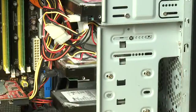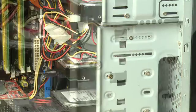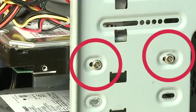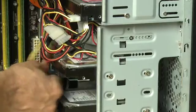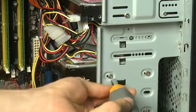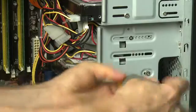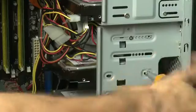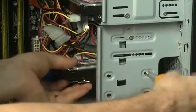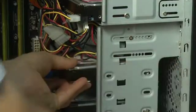To remove the drive from the case, locate it and you'll find it connected by two or four screws, generally along the side of the drive. Before you do anything else, remove the data cable and the power cable from the hard drive. Then start to remove the screws. Typically a hard drive inside a slot is supported by a piece of metal underneath, but double check — if it's not, be sure to hold on to it while removing the screws.